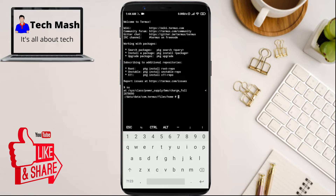Press enter. Here you can see a number which is 2878 followed by three zeros. This is my actual current battery capacity. My original capacity was 4000 mAh when I bought it — it's a Xiaomi Redmi Note 5 AI. The capacity was 4000 mAh when I bought it around 4 years ago, and after that time it has degraded. Now the current capacity is the first 4 digits, which is 2878 mAh. You don't need to count the last three zeros — just the first four digits is your actual current battery capacity.